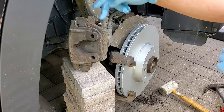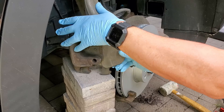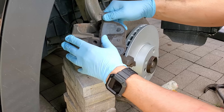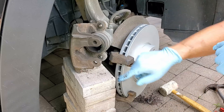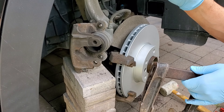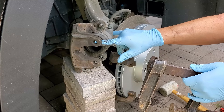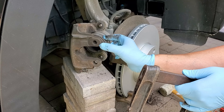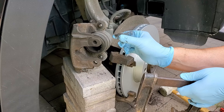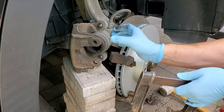I've reinstalled the caliper mounting bracket with the two Torx bolts. I unstrapped the caliper and need to remove the old pads. The next step is to use a clamp to compress the piston back into place. That's why I released and took off the cap on the master cylinder — to allow me to not have too much pressure when compressing this back. As it stands, I do not have enough caliper space to install the new pads and the new rotor because both have lost material, and that's why the caliper has been depressed so much. I need to reset it.